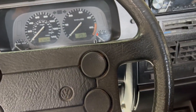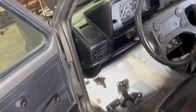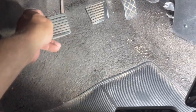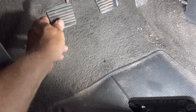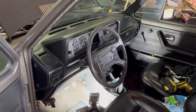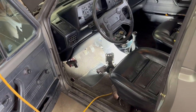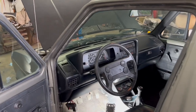This is my daily driver and I just want it to be good. The clutch pedal is apparently worn out — I don't know how much of that side-to-side movement is normal. There must be a bushing in there that's worn out, which causes the alignment of the cable to be off. I'll have to fix that before I go back together. I'm going to convert it over to hydraulic and save the cable in case I want it for another little truck I've got.